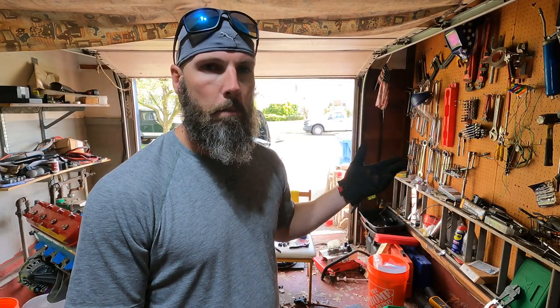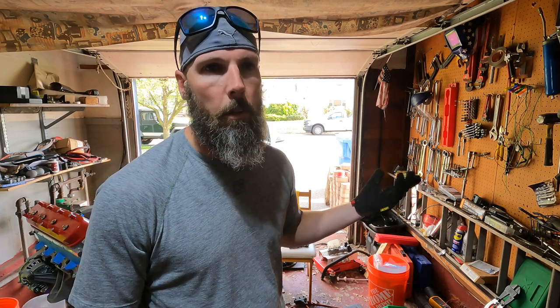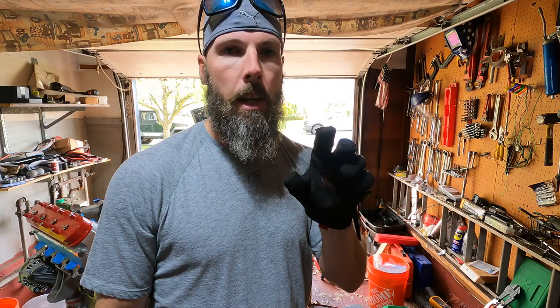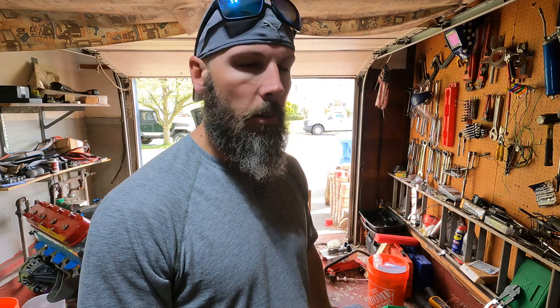Now we got all that stuff disconnected - basically the minor little stuff that's in the engine compartment. Now we're going to crawl into the footwell of the driver's side of the vehicle and crawl up underneath and twist and mess our backs up. I want to say it's six 13-millimeter nuts - four of them are holding in the brake booster because you're going to need that to move, and two are holding in the master cylinder for the clutch. If you have a quarter-inch ratchet without a giant battery on it, you should be able to get in there. Pretty sure you need a deep socket.